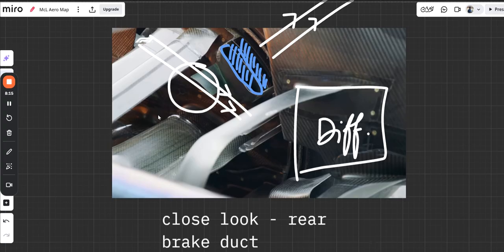Because in tires you've got two main types of degradation. You have physical degradation that happens through load, which is when you go through your turns, your corners, you go on curbs. That is physical degradation. You can't stop it because that is a physical force. But the heat is something you can control, and that is what the efficiency of the brake ducts is helping with. It is helping them in tire deg a lot. So an efficient brake duct will always help you in tire deg.